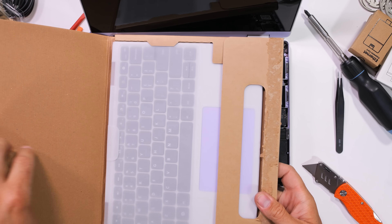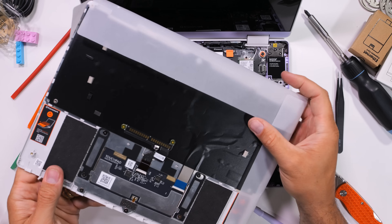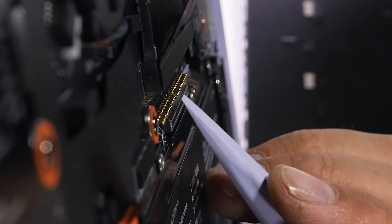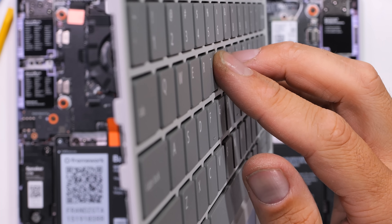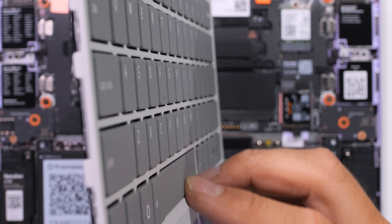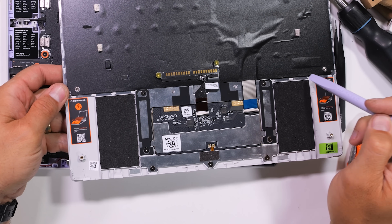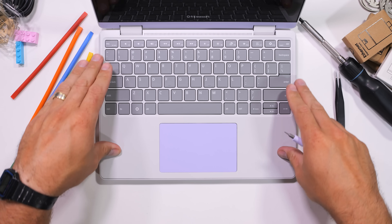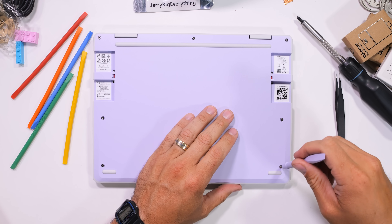For the keyboard, what's really cool is that it has no plugs — just a lot of pogo pads on the back which line up with the pogo pins on the motherboard. The keyboard buttons have some decent depth to them. The keyboard also has threaded inserts on the back which correspond to captive screws. I'll just plop the lower end of the keyboard into the frame of the Framework 12 and press it in, then flip it over to tighten the 8 captive screws on the back side.